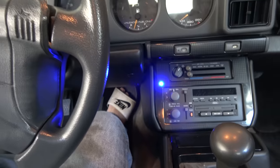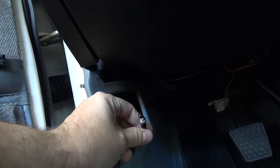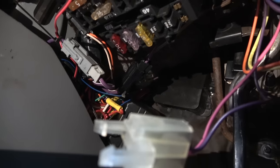Let's see if the car will still start if I first disconnect the main box of the alarm. If that works, then it's just a matter of taking all the wiring out. This is obviously part of the alarm system — it was kind of just behind there. I think this is like a little kill switch so you can disable the alarm. But under here, I don't know what this is, I don't like it. I don't like the fact that something's unplugged. Let me get my cell phone for light. Over there is the alarm control box, and the wiring is just absolute nonsense. There's a lot of weird wiring going on here, and it's all got to do with that stupid alarm box. The first thing we're going to do is unplug that thing and see if the car will start with it unplugged.